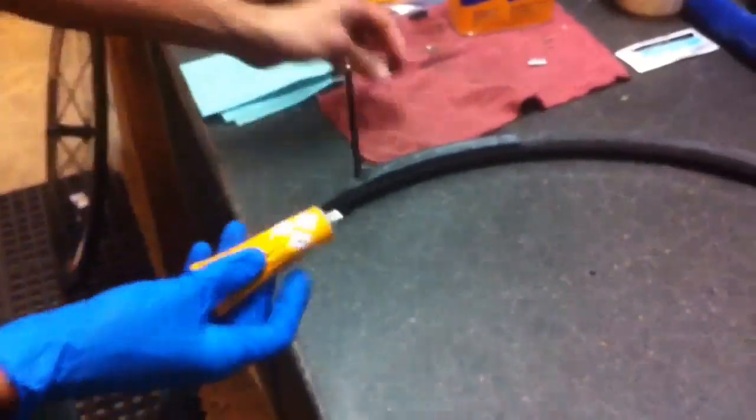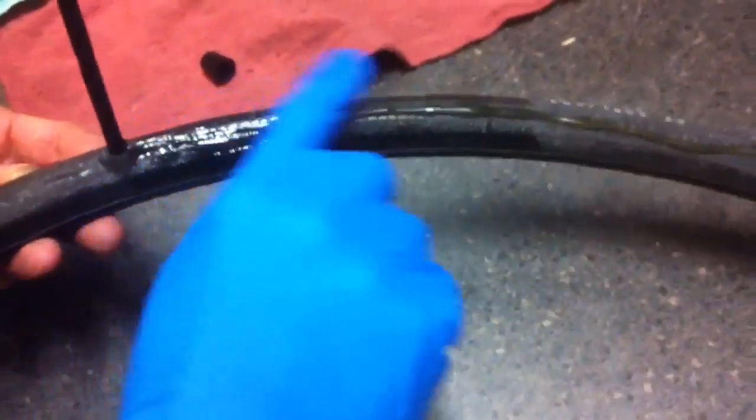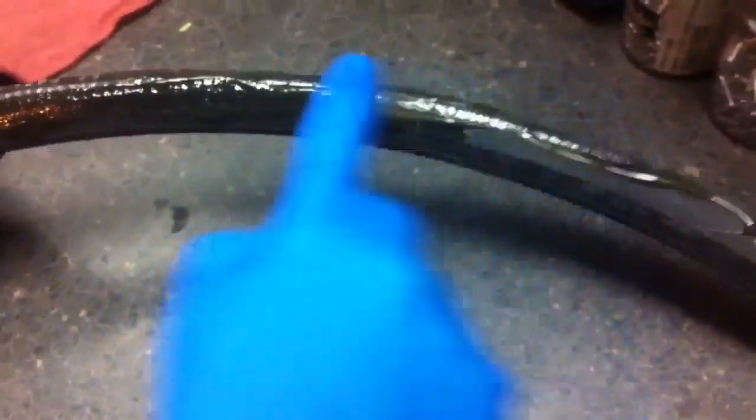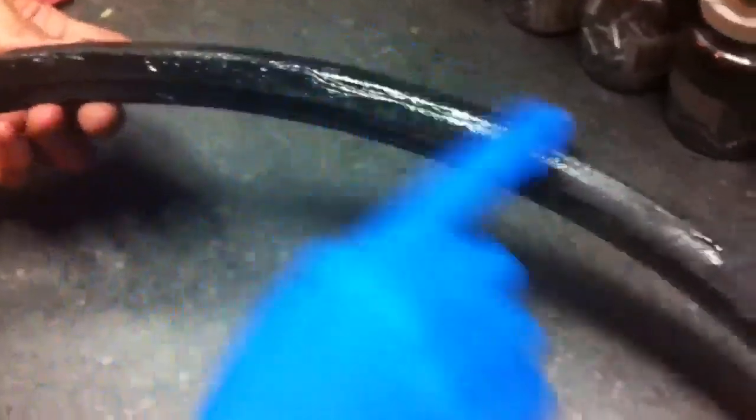We're going to be using some Continental glue — either the standard Continental glue or Vittoria Mastic 1, both work real well. I like to just put a thin little bead on, maybe working about 16-18 inches at a time. One layer, not super heavy, moderately thin — just enough to soak into the whole base tape. You want to get a nice even coat all the way through, all the way to either side of the base tape. Just go around a little at a time until you have a nice layer all the way around.